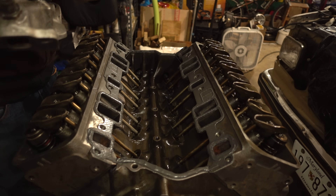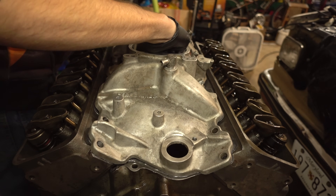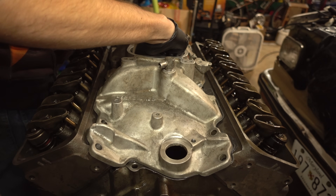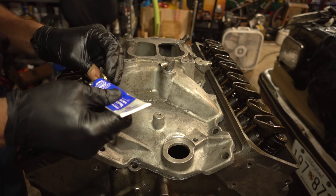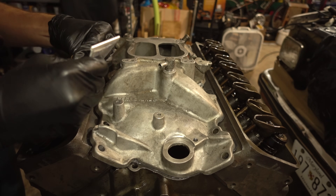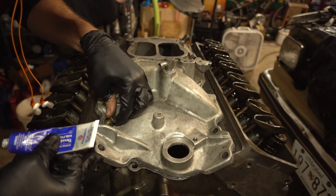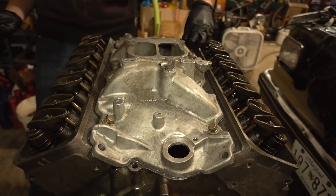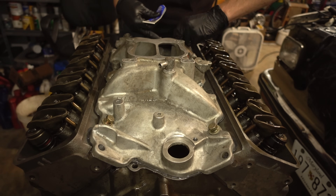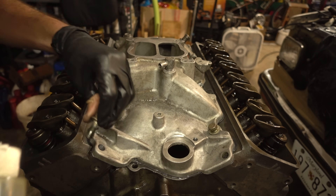Now it's been hanging out here for a little while, so let's try to get this straight on there on the first try. All the bolts except the front-most and back-most need thread sealer - the front and back are blind holes. I had a whole bunch of washers on these bolts before and they weren't quite the length I wanted, so I ended up cutting all these bolts short while they were all out. Front and rearmost ones just get a little bit of oil.